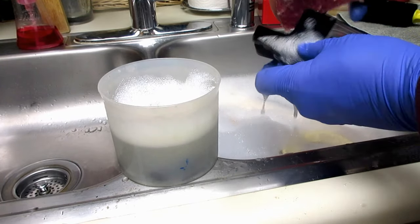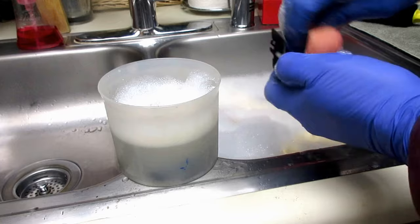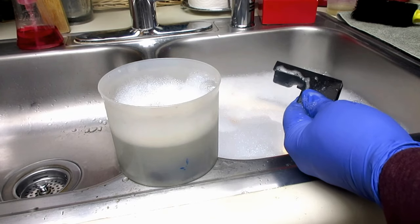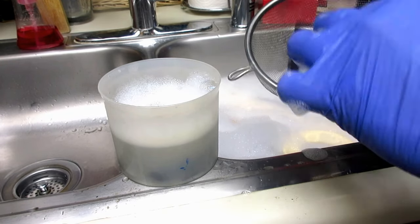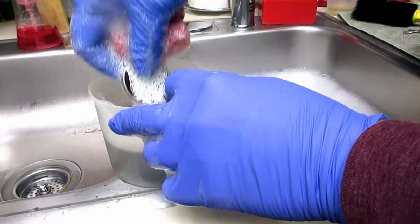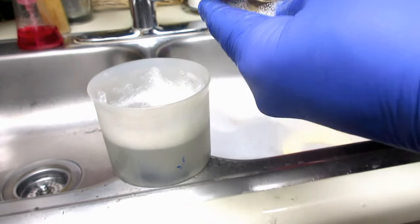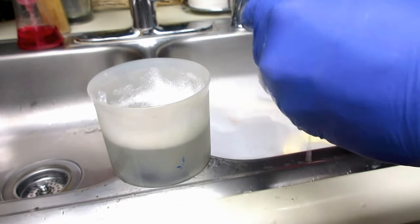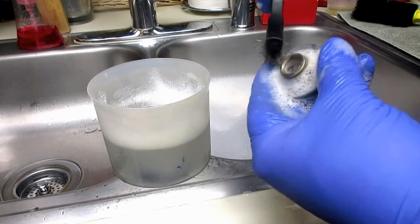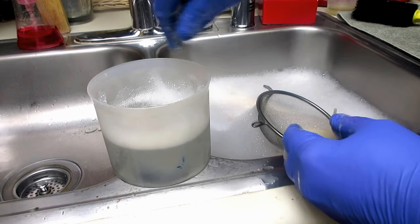And sometimes these really just soak them and rinse them is all it's going to need, okay? But sometimes there's built up gunk on them, so you got to brush them or scrub them a little bit. I put them in here so I can rinse them easily. Let's see another part in there I can show you. Yeah, here's the stop motion screw. Gets stained up in the back here. So I'll scrub that up a little bit. I can use my wire brush on anything that's stubborn.